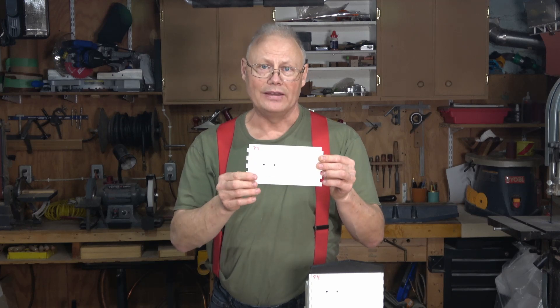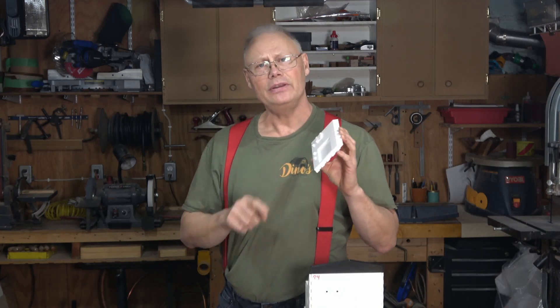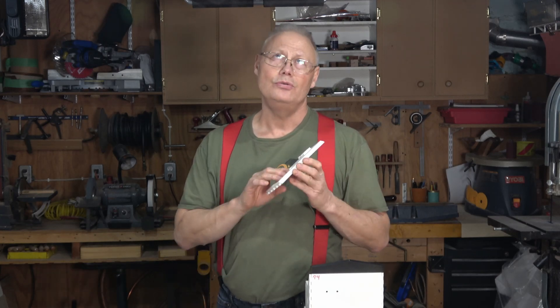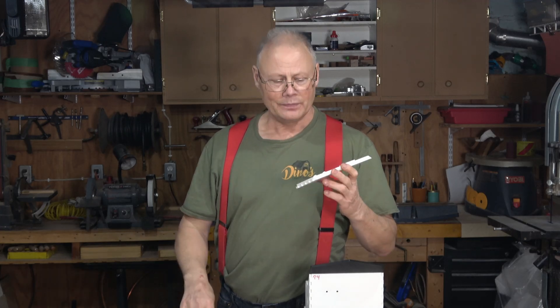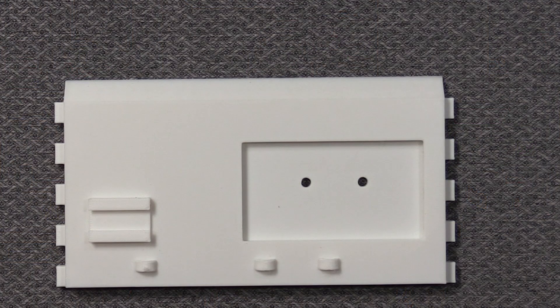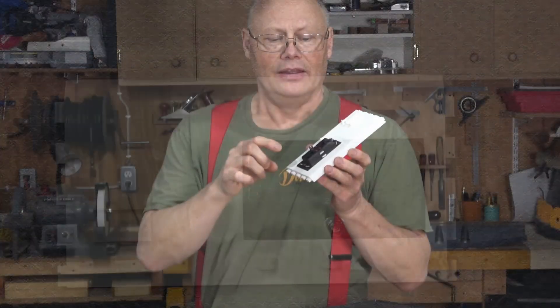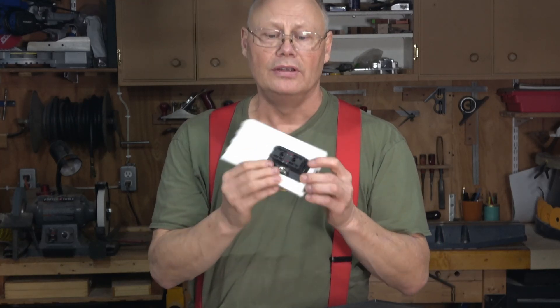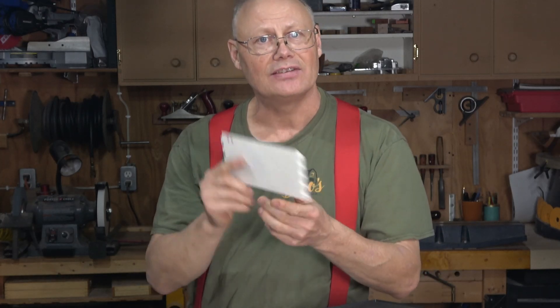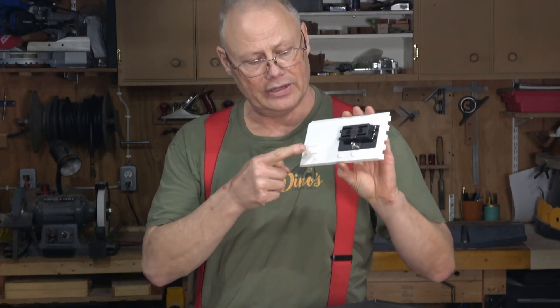Print number three has additional loops for more zip ties. I really wanted to maintain as clean and tidy a look as I could inside the compartment bay, so I relieved some of the area so that the fuse panel actually snaps right in like this — fits nice and tight, lines up nicely with the bolt holes, and gives an overall much cleaner, more secure fit while saving a little bit of space underneath the dash itself.